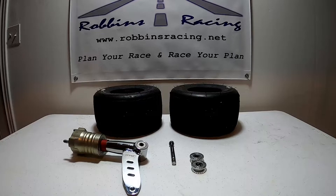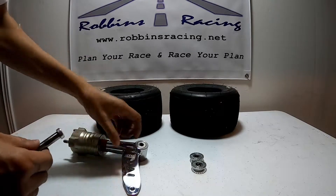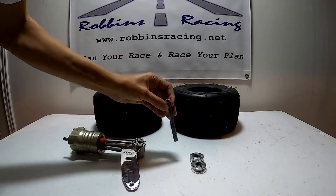In this video we're going to talk about camber. Camber is just another one of the many changes that we can make to the front end of our go-kart in order to increase or decrease the grip in the front end. With a camber change, basically all we're doing is changing the angle of the kingpin bolt that goes through the center of your stub axle.